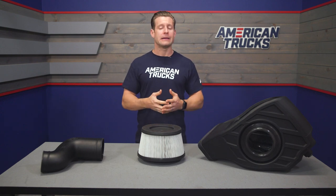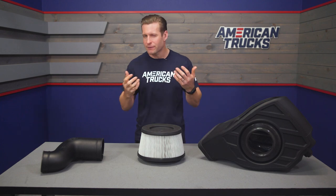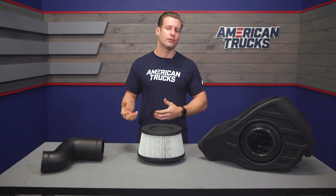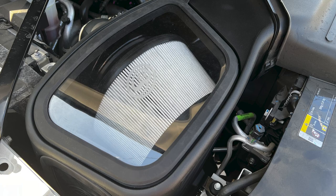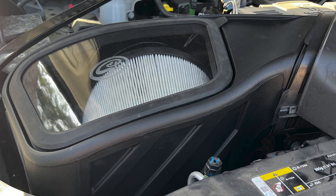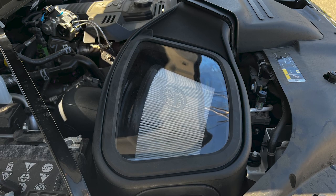When the truck is moving, it's not a big deal because you're getting fresh air through the front of the truck. But if you're the type of owner who sits in a lot of traffic, towing all the time in bumper-to-bumper stuff especially in a hot climate, this can really contribute to a sluggish feeling rig. With a sealed enclosure, that shouldn't be a concern because you are isolating the filter from all of that hot engine bay air, unlike other options that expose the filter — you get a little more sound, but those are prone to heat soak.